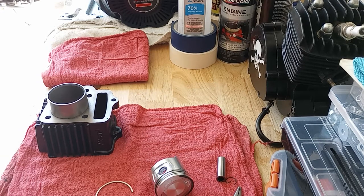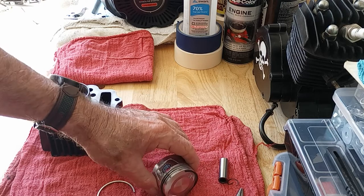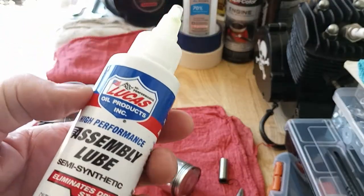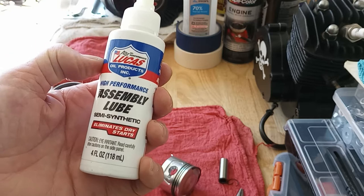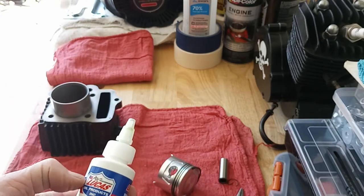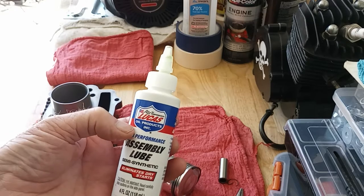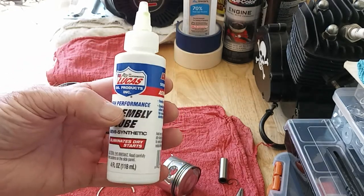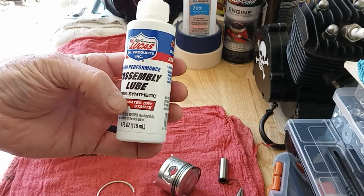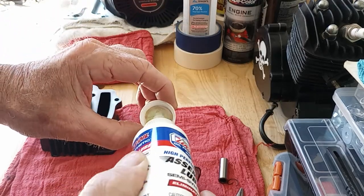Hello YouTube, this is going to be a quick video on a little bit of preliminary prep for this big bore kit. I've got the piston, wrist pin, wrist pin keeper, and rings. What I'm using is Lucas assembly lube — this stuff is real sticky and tacky, it's just good stuff. You put it on and it stays on. You can prep your pistons and cams ahead of time, and two or three weeks or a month from now this stuff will still be there. Motor oil, not so much — with motor oil you need to assemble the engine right away and fire it up.